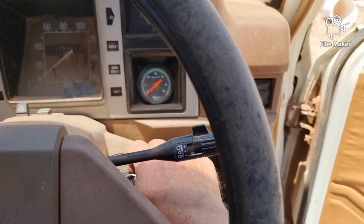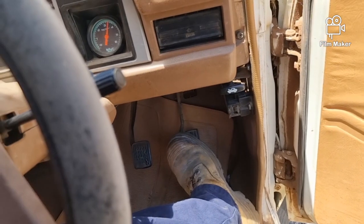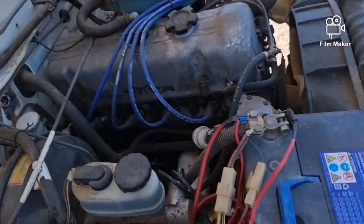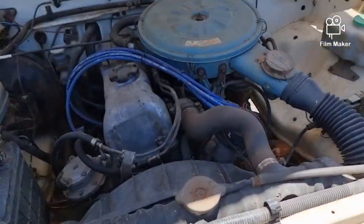Alright, I'll stitch all these videos together tonight, hopefully get this thing out of here and put the 720 back in. Moment of truth - that battery was a bit sad. One pump, a little bit of throttle - battery swings are over. I think the vehicle it came out of probably wasn't charging. The old L18 - A87 head, kidney shape, closed combustion chamber - the heads that you find on your Triple S's.